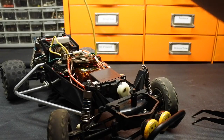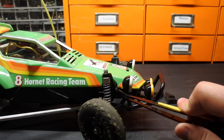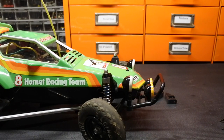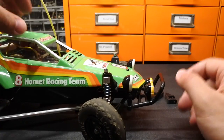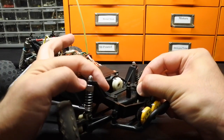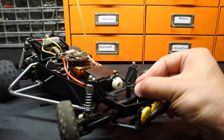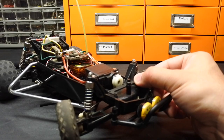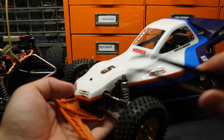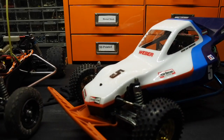This will allow you to reinstall the body without a single modification to anything. The peg sticks out from underneath the body; we put the ball end right there and we've installed this front suspension without a single cut to the body. The alternative is to mount the more robust version, put the ball end on top and route the upper link out to the upright. The geometry is much better that way — it would look like my inspiration, the Panda Cyclone, but you would have a cutout in the body. It does work better and is stronger, but if cosmetics are what you're after, you want to go with the other version.